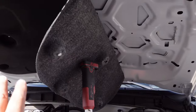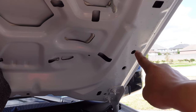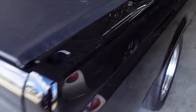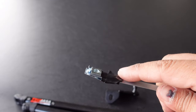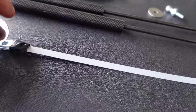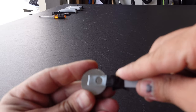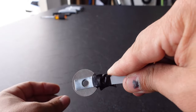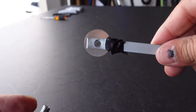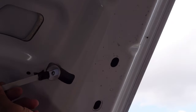I'm going to prop the hood insulator out of the way without removing it all the way, just to get access to this hole right here — that's where we'll install the top mount. In the kit you'll find this wire which is basically going to hold our nut, held in place by electrical tape. The instructions don't mention it, but I think we need to add a washer to the back side, otherwise it's going to go through the hole. So I'm going to grab a washer, slide it in until I can see the hole, then feed this through until I see the washer on the back side.